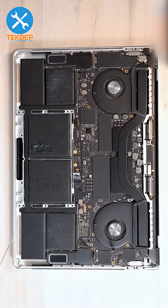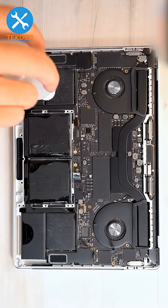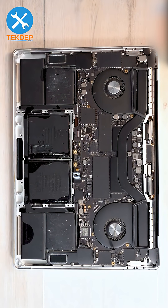Take isopropyl alcohol out of a dropper — this is going to weaken the adhesive and make it easier to pry the battery out. Let the isopropyl alcohol sit for a moment, then use a spudger to begin prying up the battery.